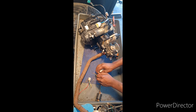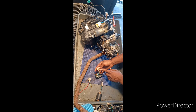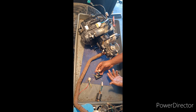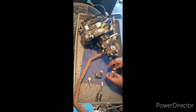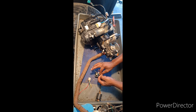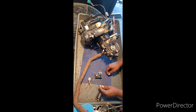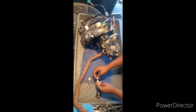I was going to throw away the recharging system but I decided to figure it out. If you look at the back of my plug there's a yellow wire and a white wire — they're very short because I wasn't going to use them. Those three wires alone will make this engine run. This yellow and black wire goes out to your ignition coil. We're going to be putting multiple grounds on here. Your ignition coil has a pigtail with a yellow and black wire — just like the wire out of the CDI box — put those two together.